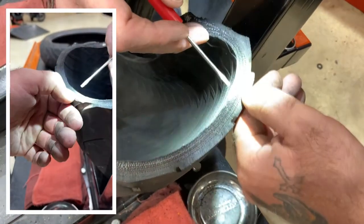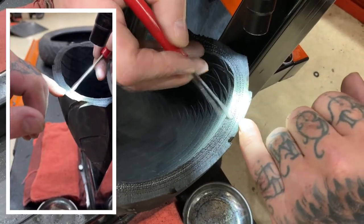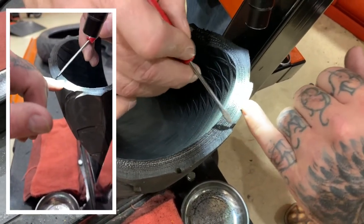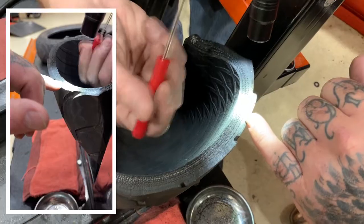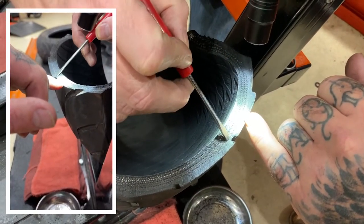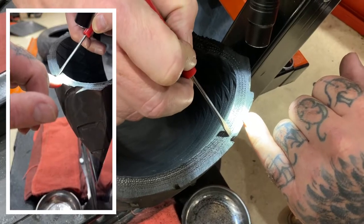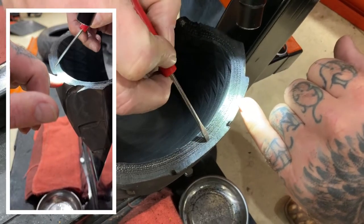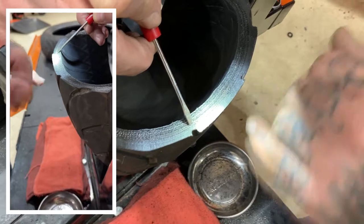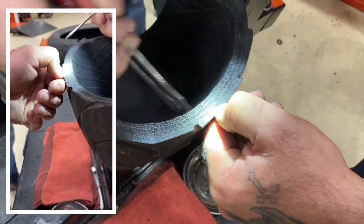If you're not into tires, it's hard to see the difference — to see how the cords are and how they're meshed together. These are different cords, different layers of rubber, different layers of how they're weaving them. Because when they say you're down to three thirty-seconds and you need to change the tire — you can see why, because that's the last cord. You're there, you're done. You're running cord to cord — you're on a maypop. That's the cord you're hitting.